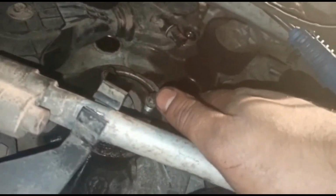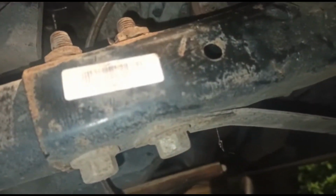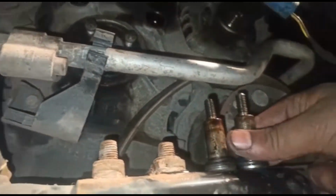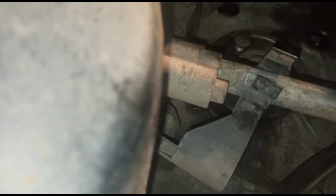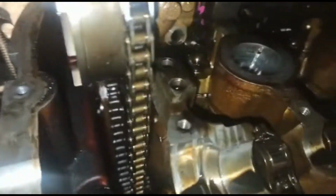So there's one of those guider bolts, Torx bolts, one in here, and then the one I showed you earlier at the top. So taking those out. Here they are, the two that I've taken out. Now it should all be loose in there. I've left the top guider bolt in there because I want to take that out from the top last. So we do that one now, just so I can pull it all out. So I've got that out.